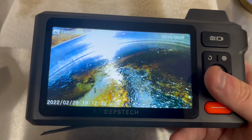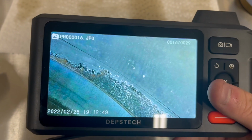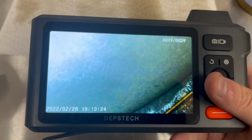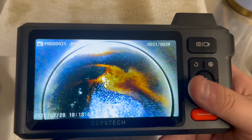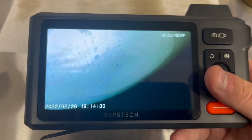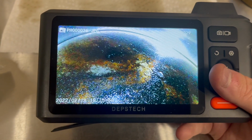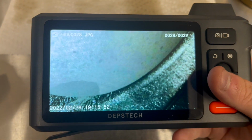Number 3, much wetter, and some carbon buildup, but you can see not really much detonation. Just, you know, a couple of aluminum flakes. The valve looks good. I can't really see, maybe a couple tiny specks. And then as you get to number 2, very wet. I don't really see hardly any aluminum on it, and that looks fine. And really basically no aluminum on the valve, maybe a speck or 2. And then lastly, number 1, very wet, almost entirely carbon, and maybe like 1 flake or 2 flakes on the valves.